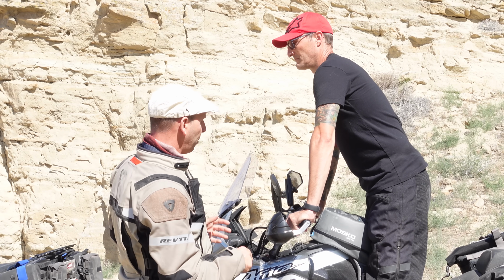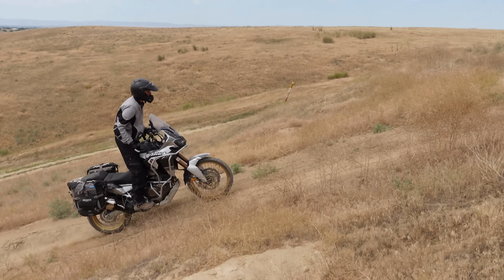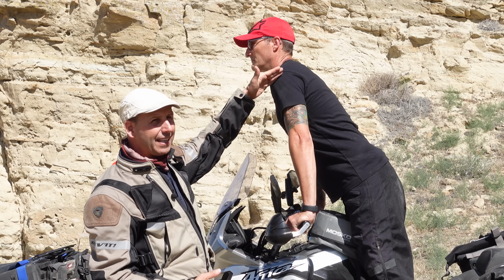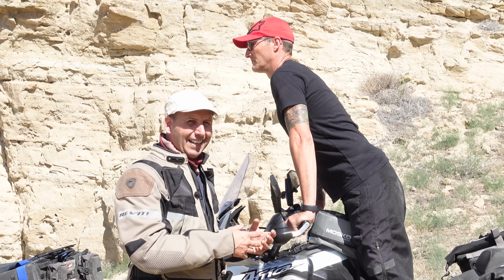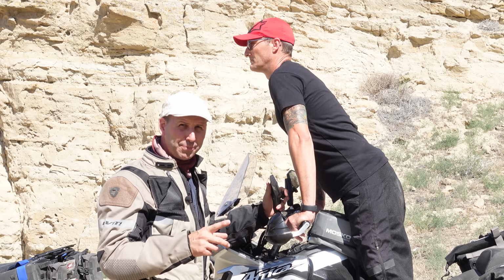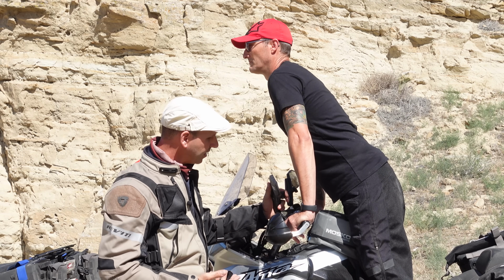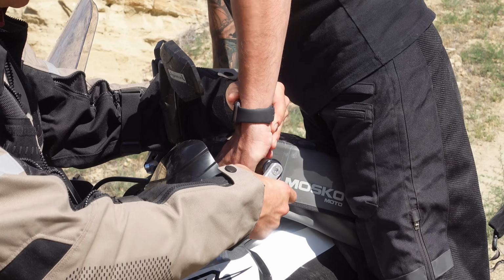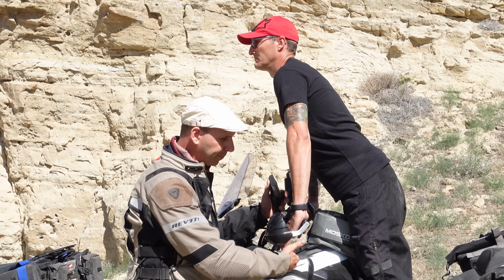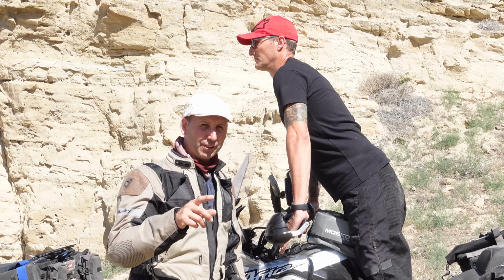There is one minor adjustment we can do here. If we're moving forward, this is where things really get messy. If you're going up a hill, if you're riding aggressively or fast, we end up with the shoulder leading the hand. This is when you begin a negative stability stance. There's not a lot you can do when you're at this height and with this handlebar setup, except you can adjust the levers. What you'll notice is we have a nice L shape on his wrist. What we're going to do is over-rotate the controls so that we straighten out the wrist, and now you're on top of the handlebars. The levers are now down below, and that provides better stability. It's not perfect, but it's definitely an improvement.